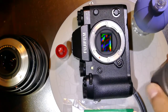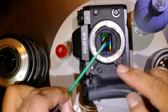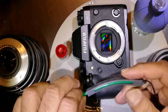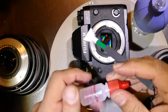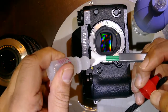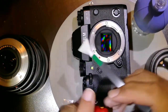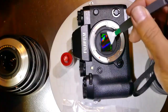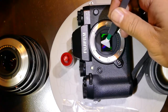We do an inspection and locate the dust. For this demonstration I'll be using a curved swab. You can use the swab by itself, but I highly recommend the curved swab handle, which is very handy and produces optimal angles. We're going to add about two drops of Smear Away and allow about five to ten seconds for the swab to saturate itself.